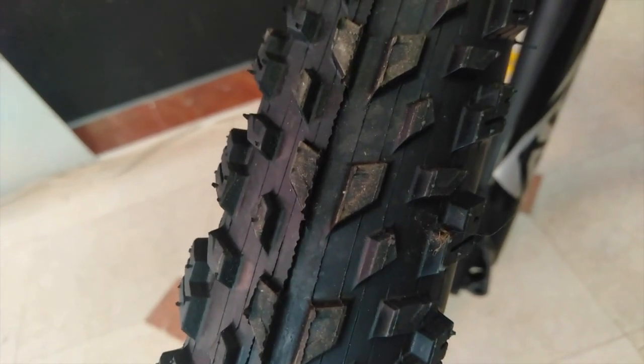Okay? Look at a mountain bike. On a mountain bike such as this, we'll look at it and you'll see there that the pressure is between 35 and 65. This is because the tire is wider. That's why on your car with such a wide tire, you only put 30, and when you have more weight, more people, you put how much? 35. So that's based on this tire.